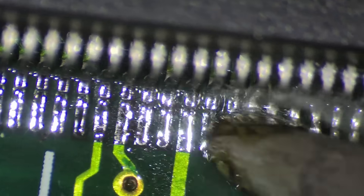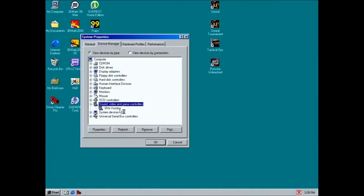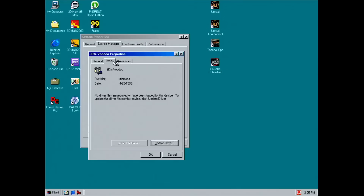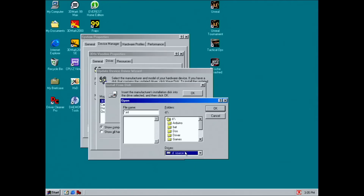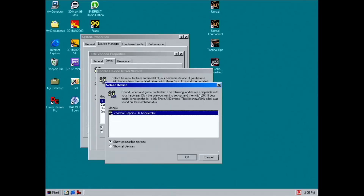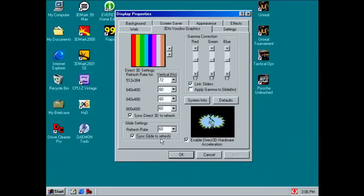What I understood is that this card didn't work at all — when you plugged it in and started a 3D game, the screen just remained blank or black. Now we can test it, and if there's still something wrong, we can go ahead and debug further. It's being detected by Windows. Unfortunately the Windows drivers are not great — I usually update immediately because the drivers that come with Windows 98 are not the best for later games. So for this we need the latest drivers. After a restart, we should be able to figure out if this card works.